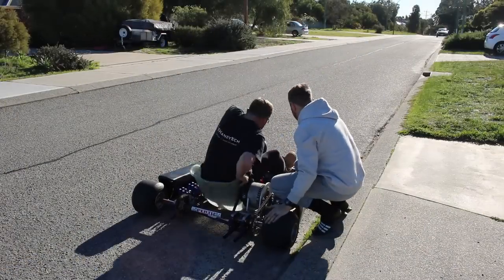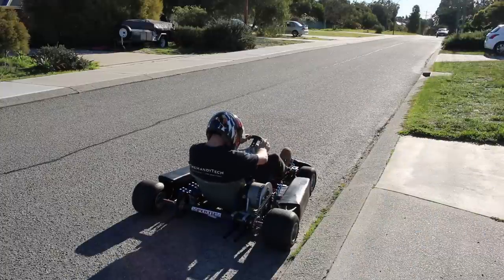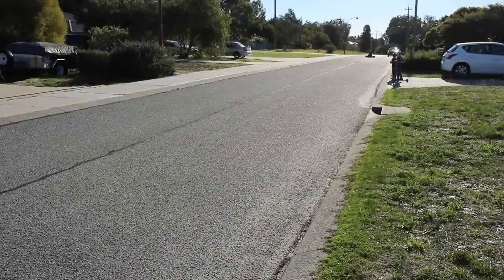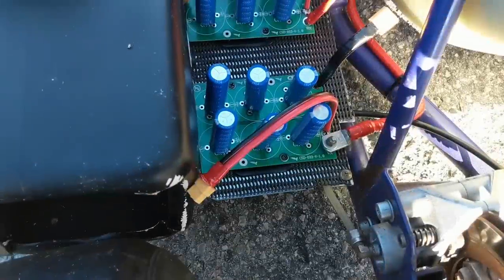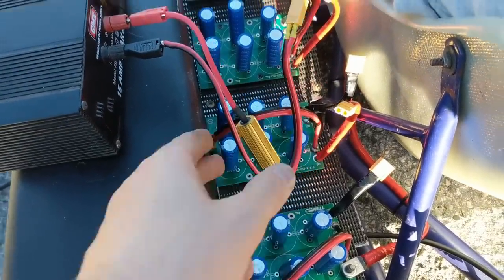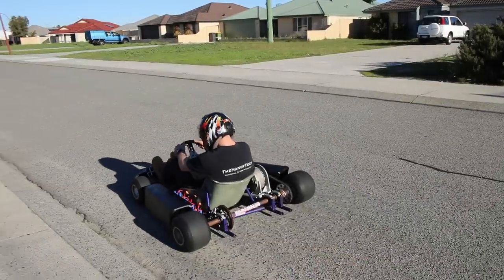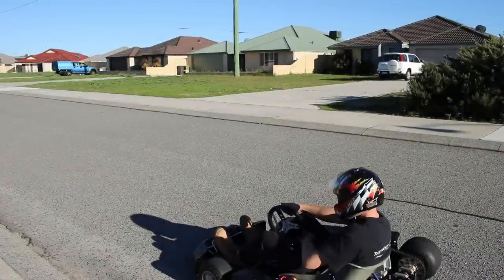We took the go-kart outside and tested it on a low current setting, just to make sure the system works and to monitor the voltage levels and behavior of the capacitors. It was a pretty mild run, but it already answered a couple of questions. One cool thing about super capacitors is how fast they charge — we could quickly separate the boards, plug the power supply in, and they'd be charged again in less than a minute each. This meant the battery pack lasted much longer as well. It's also great for testing, meaning we could play around with settings while it charged and then have another go immediately. The noticeable difference is in the initial momentum, with a nice lurch off the line.